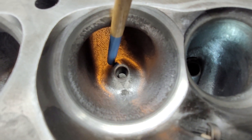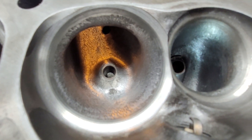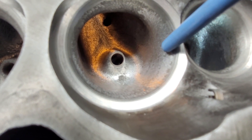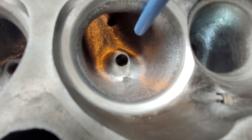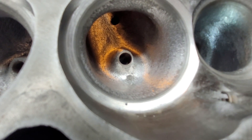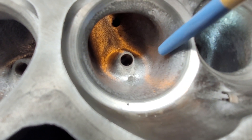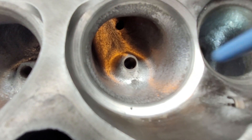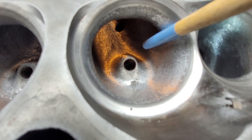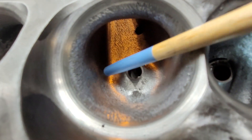When the air is coming through, we had a lot of really good comments on that. One comment was it's a hot wall because it's next to the exhaust, so you're not going to get any fuel puddling there - and he's absolutely right. Also, if we ran a string in here while the engine was running, it wouldn't be on this side, it would be on this side - the air wants the shortest path, coming along the roof and right out through the short side radius.